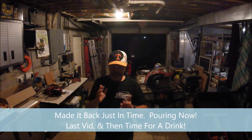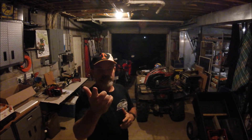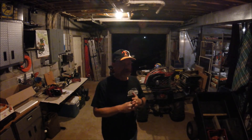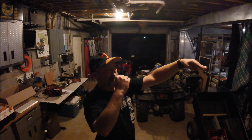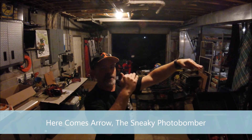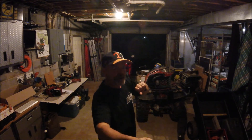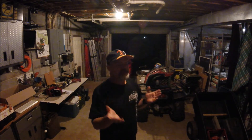Same day as the previous videos where I just finished with the horn upgrade and the LED upgrade on the VFR. Took it out for a spin this evening to fine-tune and see if I had the lights where I wanted them. Not bad — not bad for eyeballing it. They were only off maybe an inch. Sat down in the parking lot, put the bike up on the center stand, aimed it down the road, looked at where the low beam and high beam were sitting, then configured the LEDs to sit just below the low beam and slightly out to the left and right — so that when I go into a corner and turn the handlebars, the light goes with the bar instead of being linear with just the headlight.